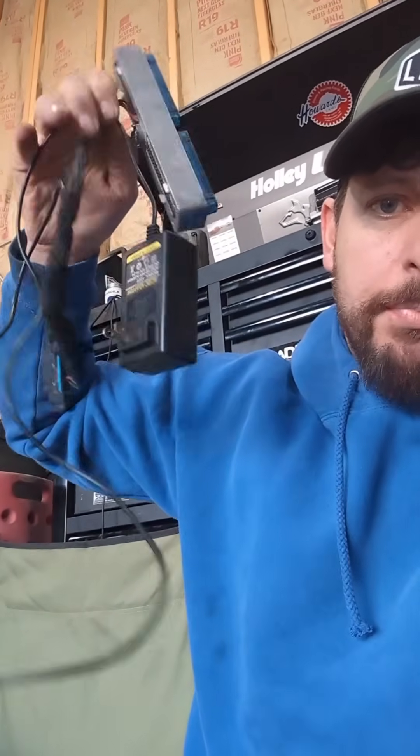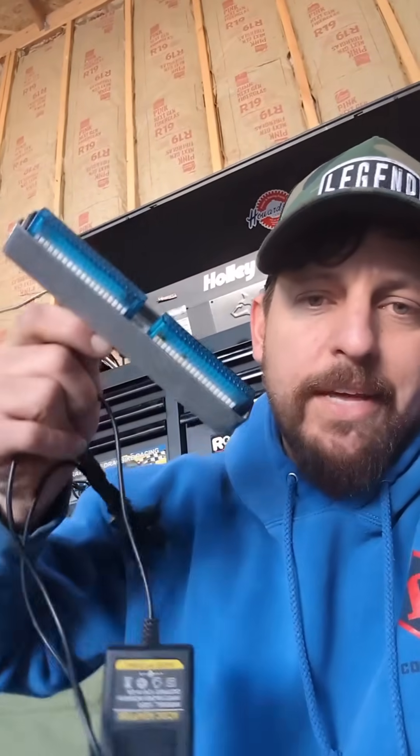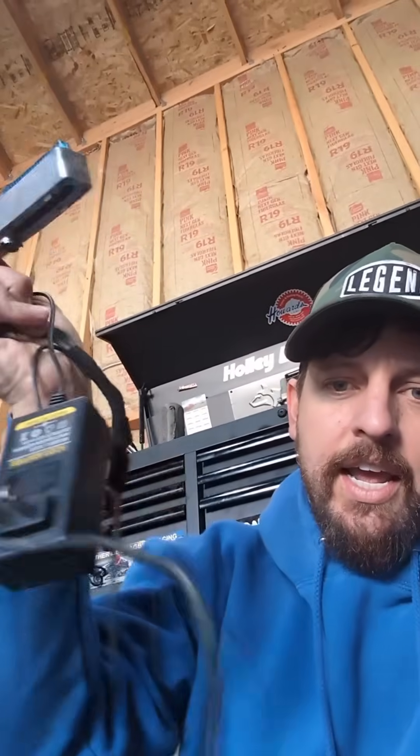Bench flashing P-59s is the way to go. The first thing you're going to need is a bench harness. You can make your own out of junkyard parts if you want — I made my own years ago — but you can just get online and buy them for pretty cheap now, even on Amazon. Just type in P-01 slash P-59 bench harness. If you're willing to spend 50 or 100 bucks you can have a pretty nice one. I put this thing together for about 10 bucks — it's a power supply, the blue connector from the harness, and an OBD port.